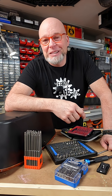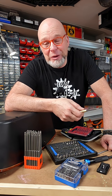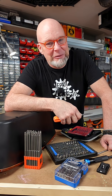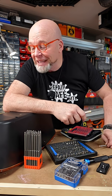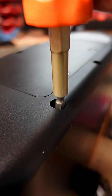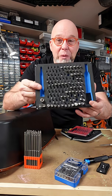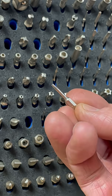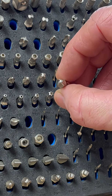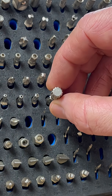It's not in the financial interest of some manufacturers to let you repair your stuff, so some tactics are used — such as safety screws. The most common is just placing the screw so deep down a narrow well, which requires thin long-shafted screwdrivers. Then there are the weird shapes: pentalobe, hex security, tri-point, tri-wing, torque set, clutch, game bit, spanner, triangle, and spline, just to name a few.